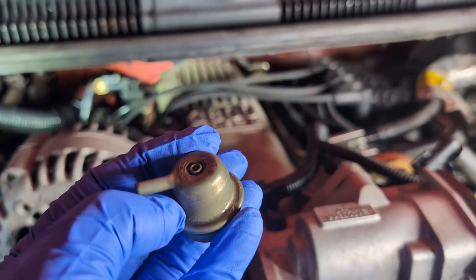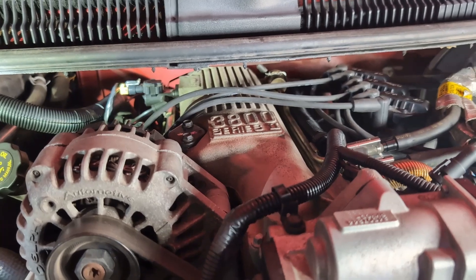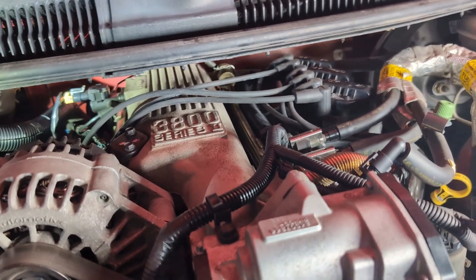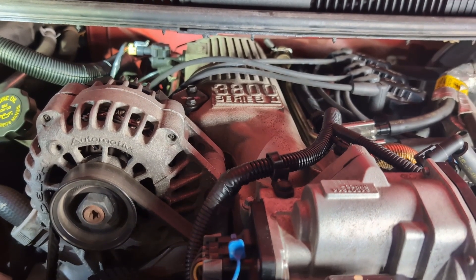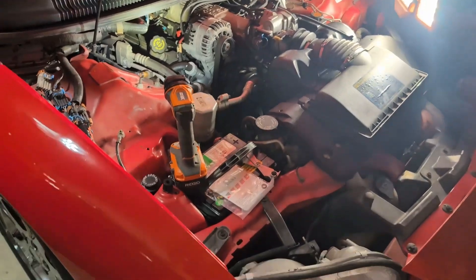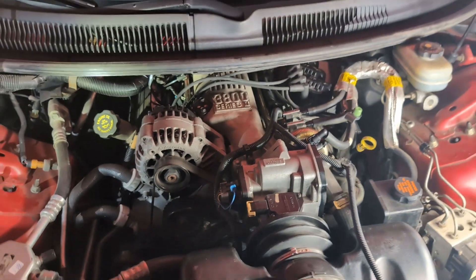There's a snap ring that covers the back side of the regulator. To get it off you'd have to be a magician — get your arm back there with a mirror and snap ring pliers and pop it out. I don't really think that's possible, so instead you have to pull the fuel rail off. Had they put the fuel pressure regulator up front, this would be a three-second job. Because we have to pull the fuel rail off it takes a while, mostly because of the design of this engine — they wanted the big sloping body, so the engine is way back there.